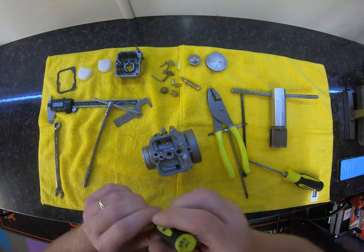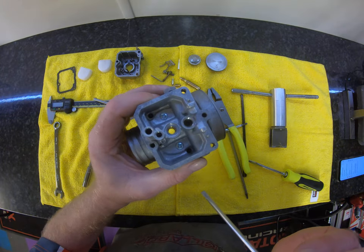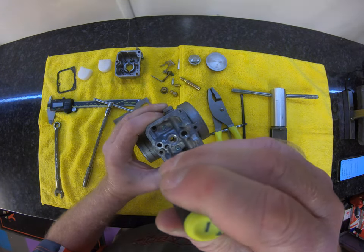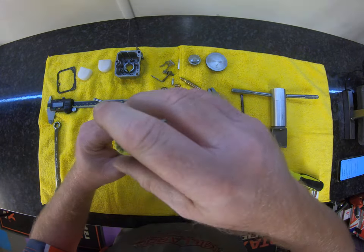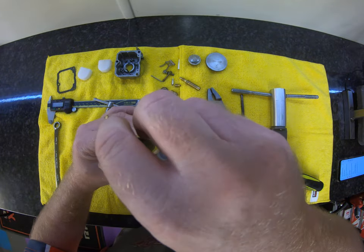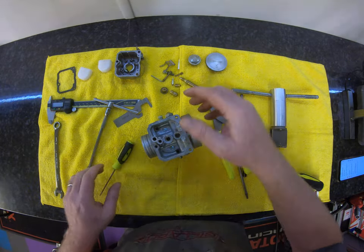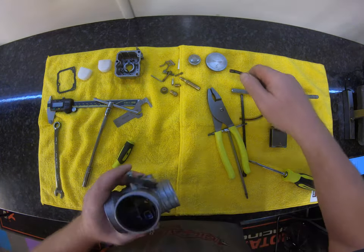Inside you have the smallest of emulsion tubes — very, very small. Very gently, just turn and take that off. This is where, when it comes out, you want to clean up the sides — you don't want these threads getting caught. That thread will go back in but won't come back out. So that's where we are — tube off.